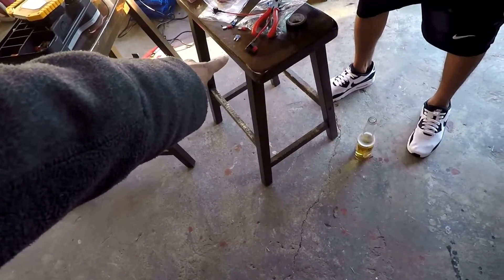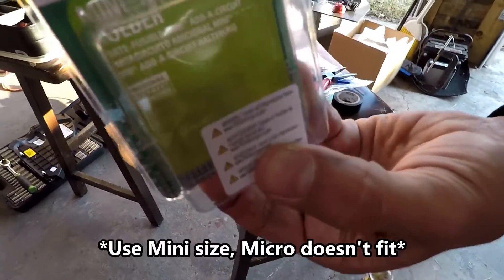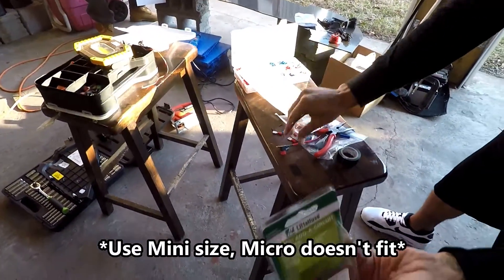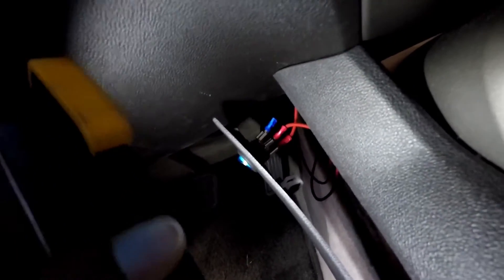Make sure you get a size 15 mini fuse. We had the wrong size at first — it didn't fit. This is the one that it actually needs for the minis; the smaller ones didn't work. So we got the size 15s in there. Now, on the back of the switch: the bronze-colored prong is your ground, the one in the middle is your accessory, and the other one is your power. We had to switch those around — when we first plugged it up it wasn't wired right.